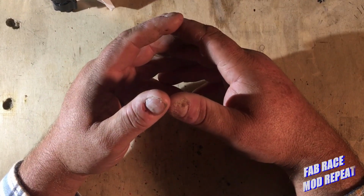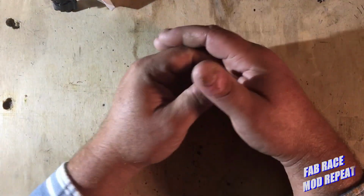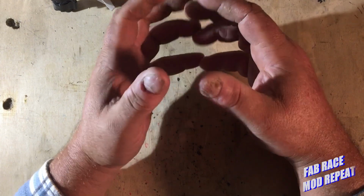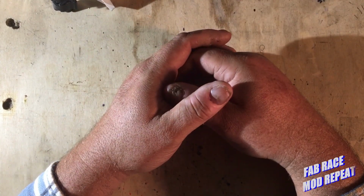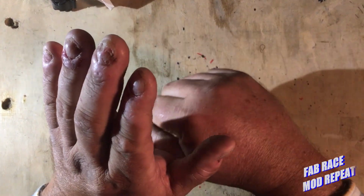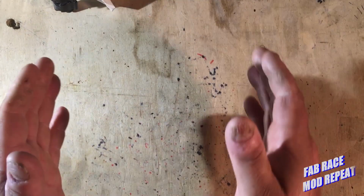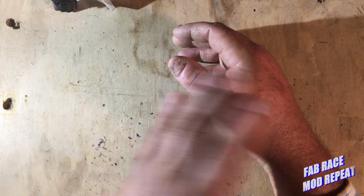But with this lift, it's a very serious issue because you've got a very high, heavy item lifted 5-6 foot in the air. And if that ram decides to let go, it's coming down. And it's coming down in a hurry. So just something to think about. The other thing about them is, if you've ever watched anybody pull an engine out of a car, a lot of times you'll see people pick the engine up and then roll the vehicle back and then let the engine down. That's to get the center of gravity down on a crane so it's not as tippy when they're moving it, because they do tend to tip left, right. They're okay lengthwise. It's just left, right.